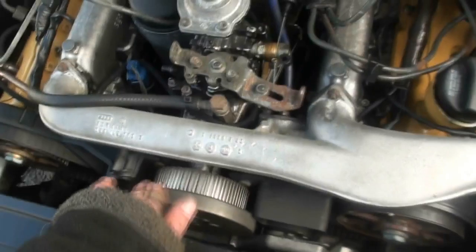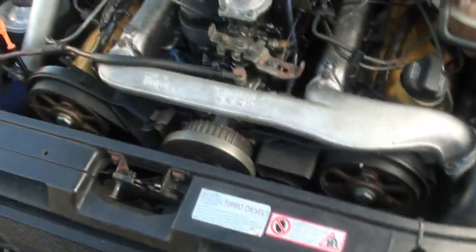What's happened basically is the pump is shagged. As you can see, it's just freewheeling that way and it just seizes that way. I'll pretty much tell you now, the plunger snapped from experience. It's got a 12mm head in it, and 12mm heads just absolutely hate revving. And this thing revs its balls off and it's snapped. So obviously the pump's seized because it won't turn clockwise, it just locks, causing the cam belt to slip and obviously the engine to die.